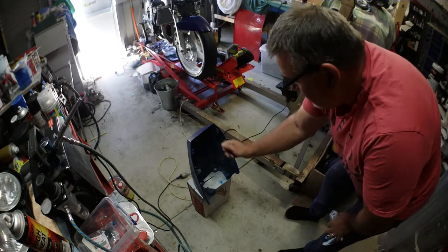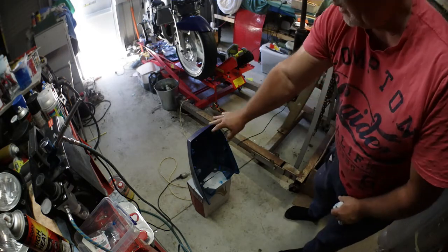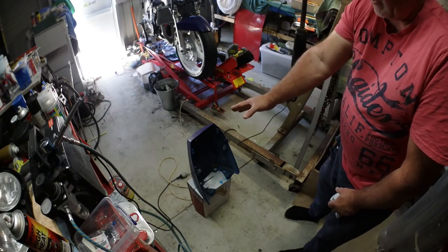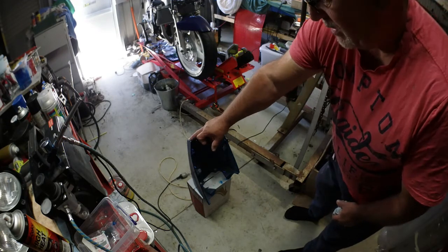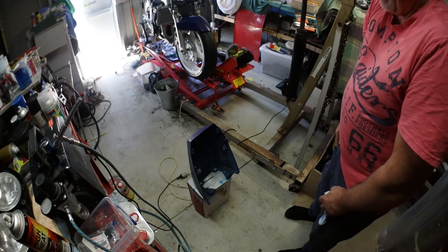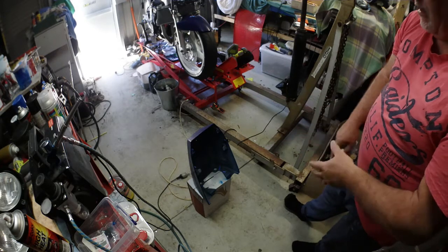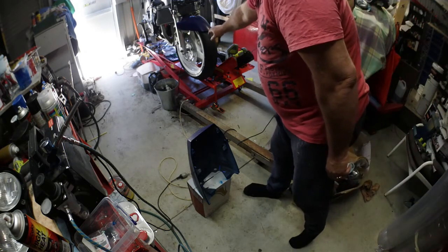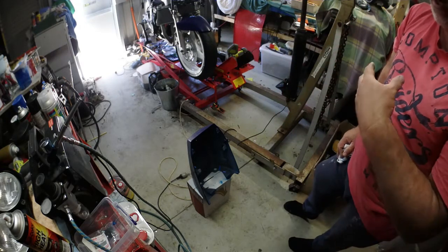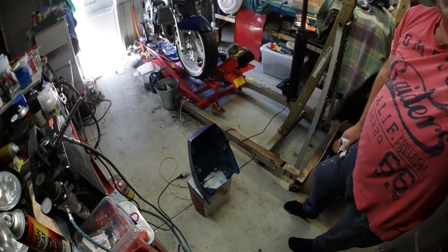Painters would say they just go down there with their gun, and true, but just every now and then they miss a little bit. This way, I did the sanding back of the colour, which means that when that happened, it didn't matter because I was going to repair it with this gun. So that's that. I just thought I'd show you that. This is what I do to just guarantee. And again on the mudguard, I'll go around the edge just to make sure that I've got all the little sharp edges and I haven't loaded them up with paint. So there we go, that's how I do it. Cheers.